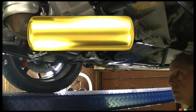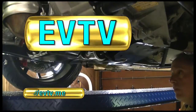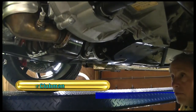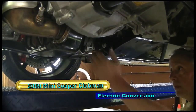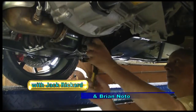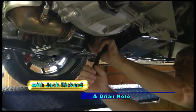Last time we were under here, at least from this angle, we were taking out the axle tubes for the transmission. We're going to begin the preparation to take the engine out. There is one engine support, a lower support here, directly behind the oil pan, and it's a 16 millimeter bolt that we've got here to do, and it's probably torqued down pretty good.